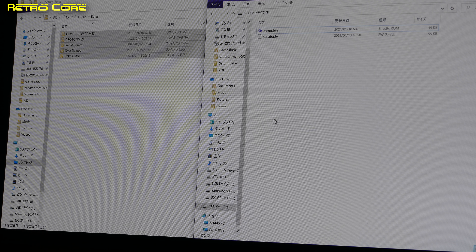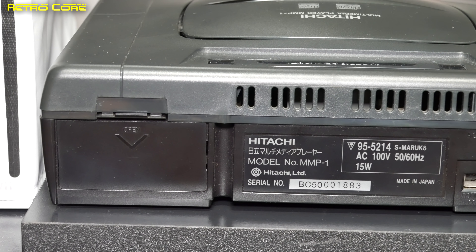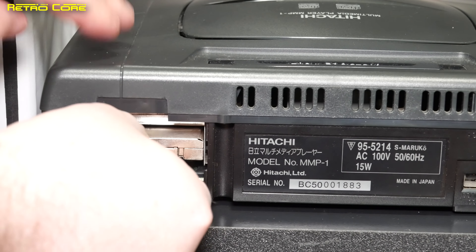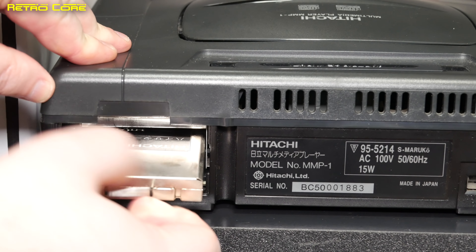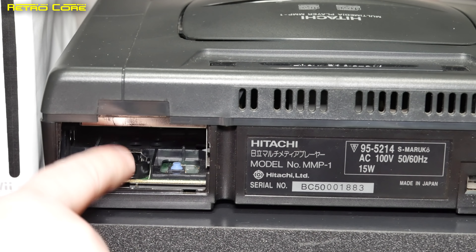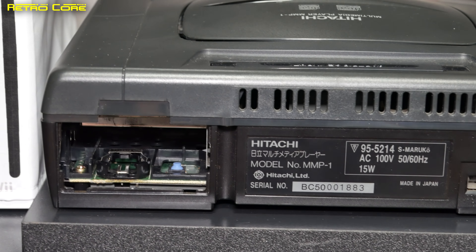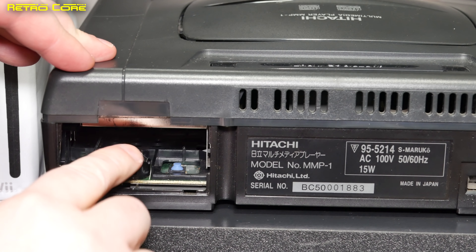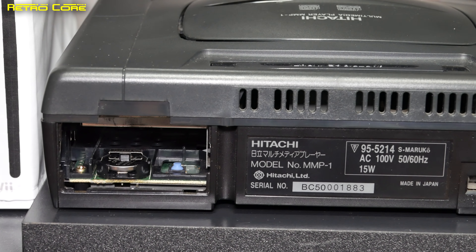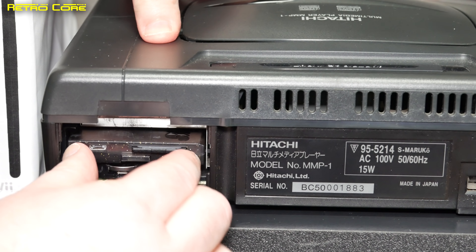To install the Satiator is very simple, but first you have to make sure that the Sega Saturn's battery is functional because if you have a flat battery, the Sega Saturn will always go to the setup screen and then the Satiator won't boot. My Sega Saturn has a Hitachi video card in the back because it's an Hitachi Hi Saturn, so that's got to come out. There is no battery in there so we have to put in a brand new CR2032 battery. Slot it into the battery holder and push it down — it will click into place. Then push in your Satiator card until it clicks and you're good to go.